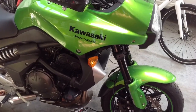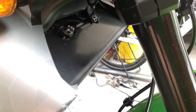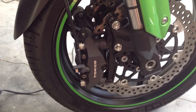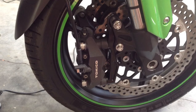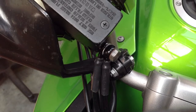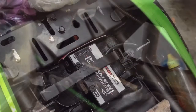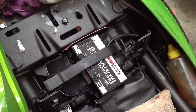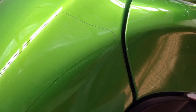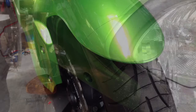That bit of silver underneath the indicator is just tape to signify the ram air - it breaks up the black and makes it look nicer. Underneath is a plastic cover over the radiator so cold air doesn't mix with the radiator heat - it's separate and goes underneath the tank. The standard brakes were a bit wooden so I got calipers off an R1 or Hayabusa, which brake very nicely now. Plus double brake lines from the master cylinder and a Hayabusa master cylinder - the whole lot is very sensitive now. The power commander has to come out as it's woeful for fuel economy. I've also got protective film over all the paint on the leading edges and mudguard.